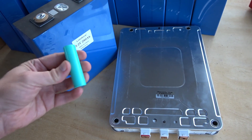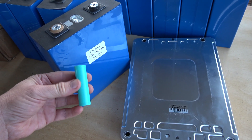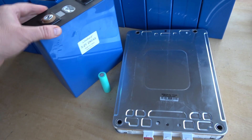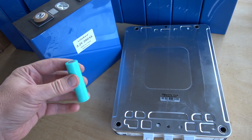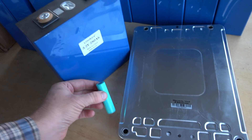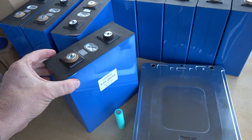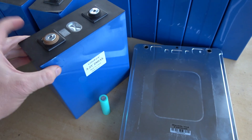Tesla, of course, is famous for using the 18650 cells that Tom Gage first used in his AC Propulsion T0. Tesla basically stuck with that and they're now modifying the cylindrical cell, but it's essentially the same thing they've been using since the early 2000s. Whereas this here is the rectangular prismatic cell — basically a self-contained cell, just like the cylindrical cell, only in a larger format.